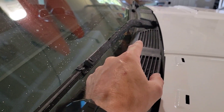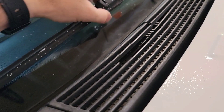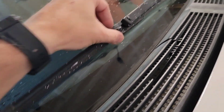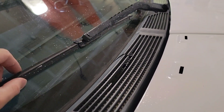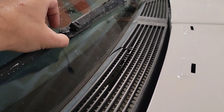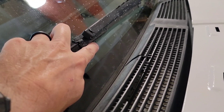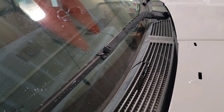The first part of this is we're just going to need to remove the wipers. One way to remember it is the actual windshield has a little line on it, so that's kind of the area where you want it. You can see somebody put that arm back on at some point, tilted it down too low. There needs to be a definitive starting point and end point for the wipers. I like to get the wiper when I put it back on to the bottom of the arm. I'll walk you through how to install the arms again.